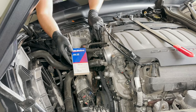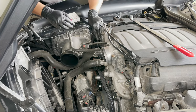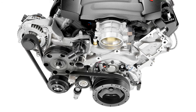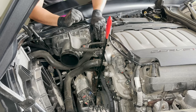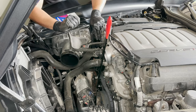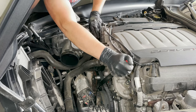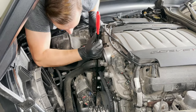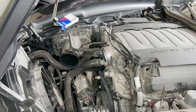We've got a brand new AC Delco belt — we'll link the part number in the description below. The belt routing is pretty straightforward and we'll show a picture. We've got the belt routed around all of the pulleys except for the alternator. We'll go ahead and compress the tensioner pulley, which gives us just enough slack to get it around the alternator. Easy as that.